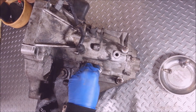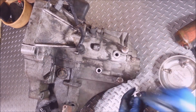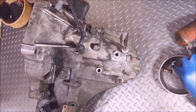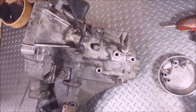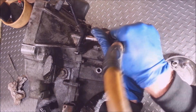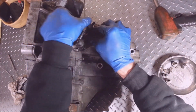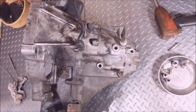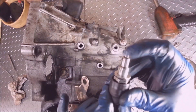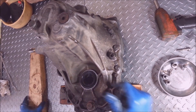These are spring loaded — there's a spring in here and there's a ball bearing inside of there. Those are for your shift detents. This is your reverse switch, 12mm on here. This is right about a 19mm — that's for your reverse light. It's resting on the input shaft, so I'm going to put a couple 2x4s under here.